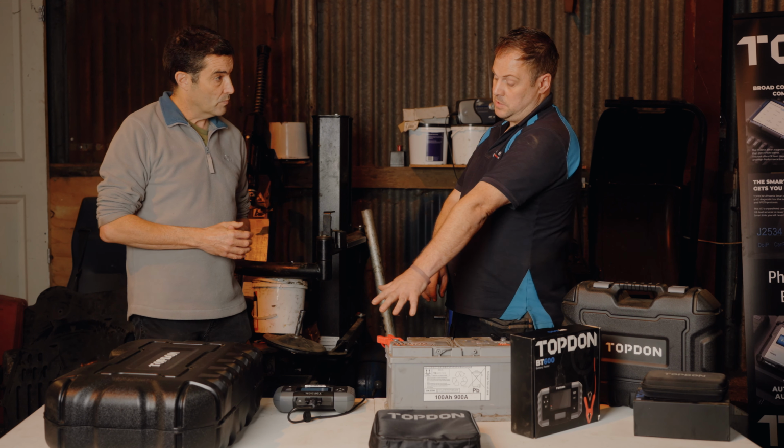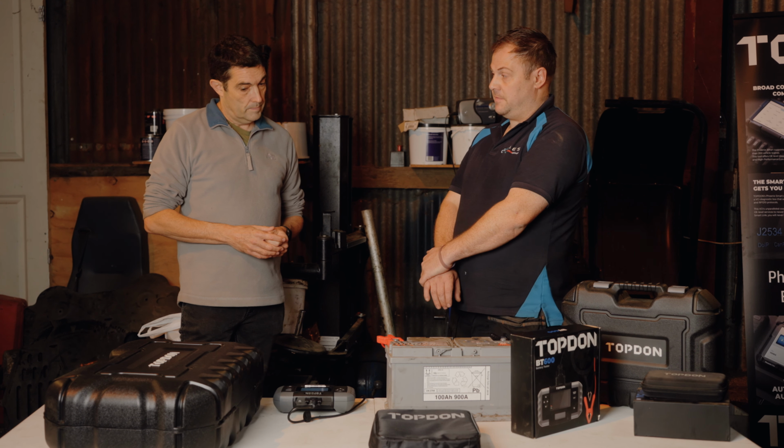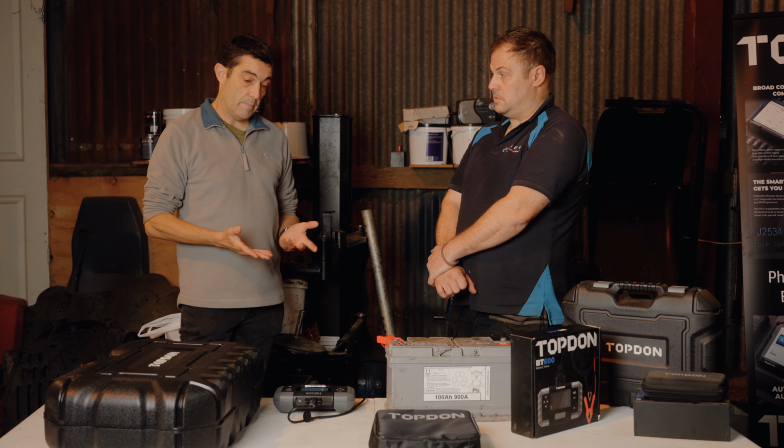We always on service use an identical machine. Yep. We check them every service. Anything below 75 state of health we recommend changing, because the first cold snap, we'll get a phone call and we can't start. And it's gone, hasn't it?